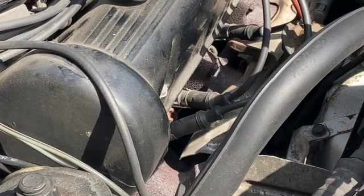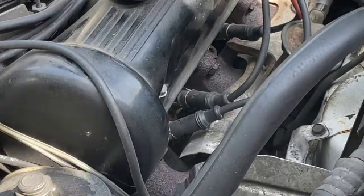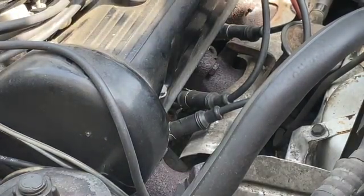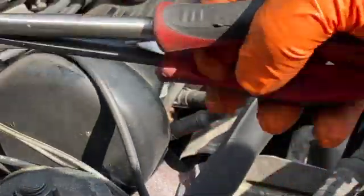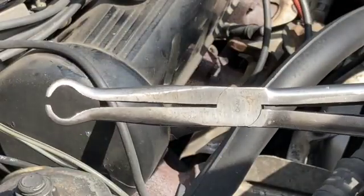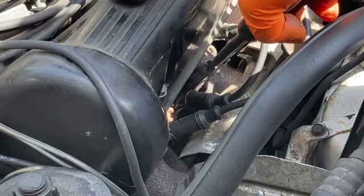The trick is trying to figure out if an engine is misfiring and which cylinder is misfiring. The simplest thing is to have the engine running. You take special pliers — they need to be insulated very well. This is not for the faint of heart, and you pull the boot off one spark plug at a time.